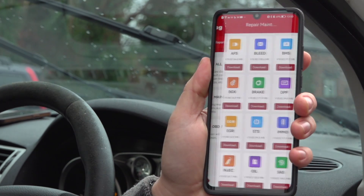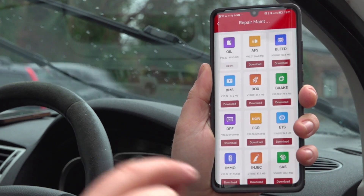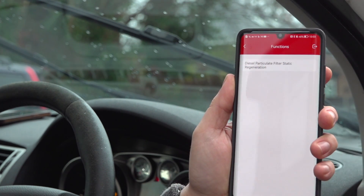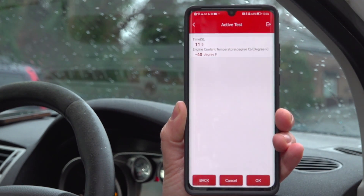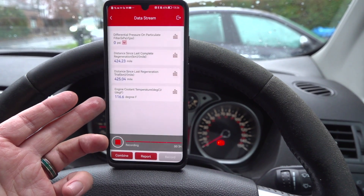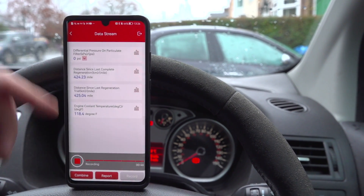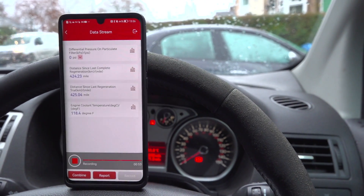There are some of the diagnostic functions, but if we go to maintenance now, there's so much more we can do. For example, I had a fault before that I suspect is something to do with the DPF, so I can download the DPF software and perform a DPF filter static regeneration on the car with just the phone. I'm going to get the coolant temperature up to where it should be and then perform the regen. You can also read live data from the car — the car is on at the moment and I can see the coolant temperature going up. I can record this as well, so if you're driving along and trying to look for a fault at a particular time, you can record that function and review it later. It's also showing me that the last regeneration happened 400 miles ago, so it probably doesn't need a DPF regen — there's something else wrong with this car, and it's helping me narrow the fault down.